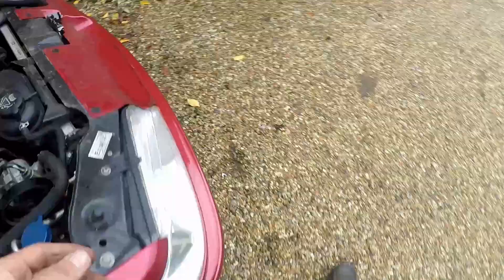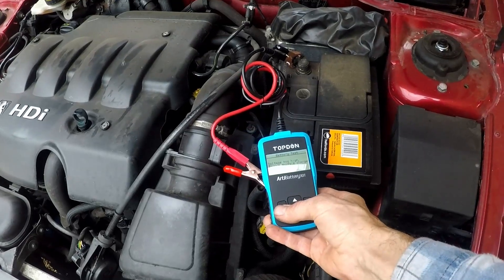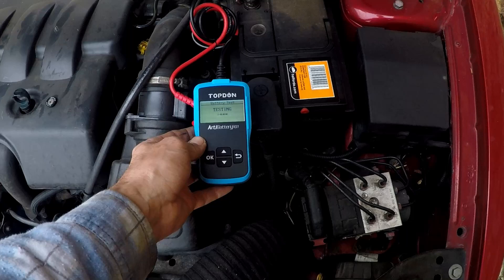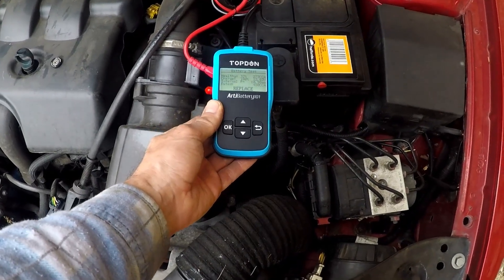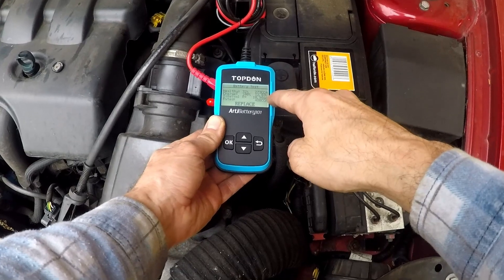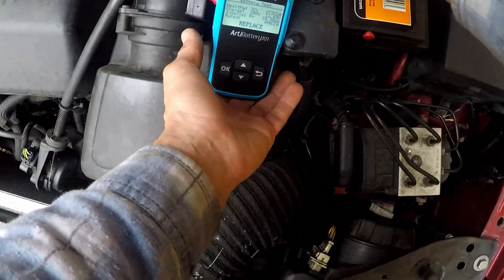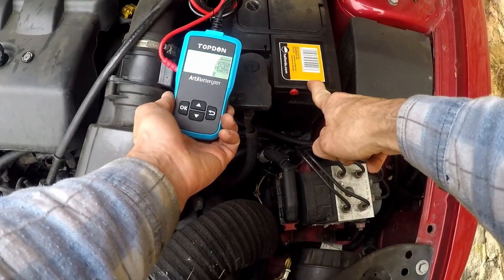Let's turn that noise off. As a final test, why don't we do a battery test since the cranking was low? Let's go with the same rating. Voltage too high — remove surface charge, turn on the headlights. That's interesting. It says the voltage is too high, so we turn on the headlights. Press okay. Testing. Nice instructions — I really like that. So it's saying the cranking amps are down, charging is healthy, but it suggests I replace the battery because of its health. Now, that doesn't surprise me. I've had the car for nearly five years and this battery was in it when I bought it, so I'm not surprised.